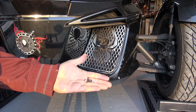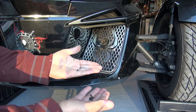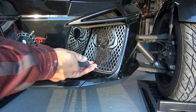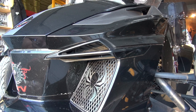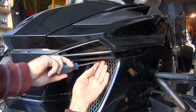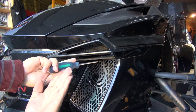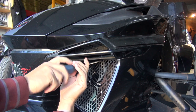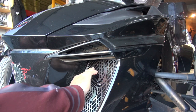You'll be left with four screws — two short ones and two long ones. The two short ones go on the bottom on each side. Using the short screw you can now choose one of the three holes available to secure the grill. Getting the top done may need you to lie down a little bit to get in there. You'll notice when you put your screw in that there's a longer reach because the grill is on an angle, so there's going to be a small gap between the grill and the block but not at the top. There we go — beautiful fit.